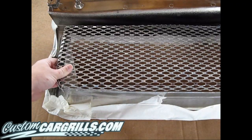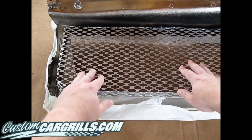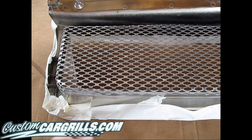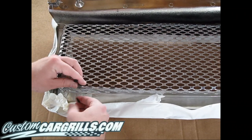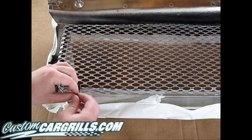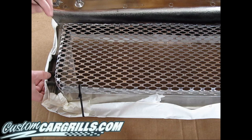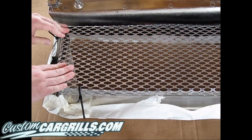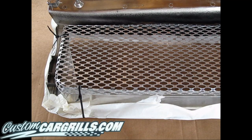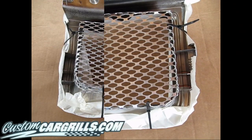The next part is to actually attach it, and this is going to be the final step before we're done. I went ahead and re-masked part of this, but what I'm going to do here is use a few cable ties and firmly attach the mesh to the grill. Obviously this isn't going to be the final installation — you're not going to keep it with visible cable ties. The purpose of this is to keep a nice firm hold so that when we use the adhesive, the grill's not going to go anywhere. You don't want to put in too many cable ties or actually adhere the cable ties to the grill itself, so use them sparingly.